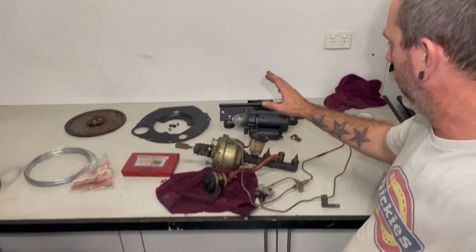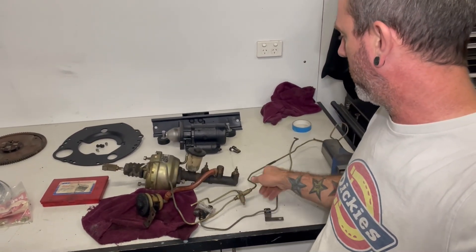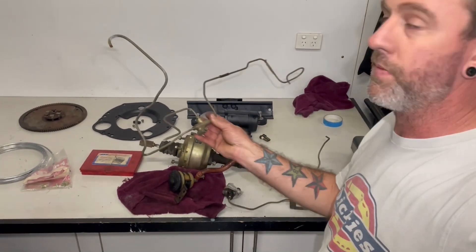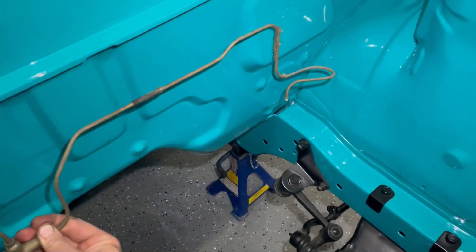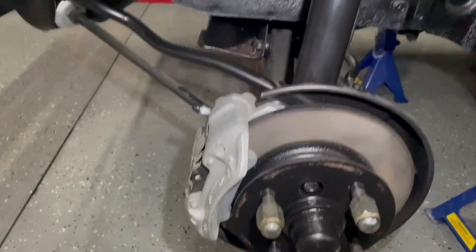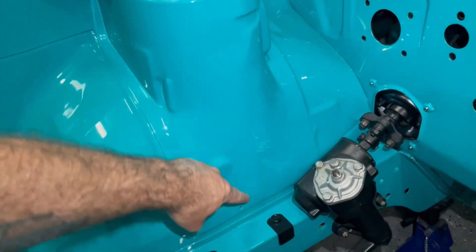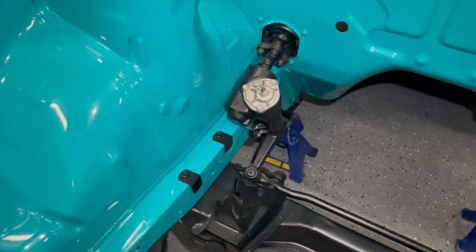I've just had to dig through all my stuff to find the brake master and booster, but I've just remembered that I don't even actually need to mount that to the car. The front brake line comes out of the front port on the master cylinder which then feeds into this T-piece, so really I just need to mount the T-piece and then run the brake line over to that left front wheel. So originally because I've filled in all the holes in the engine bay - this used to sort of mount to the firewall like so and then go in through the inner guard - because I've welded up all the holes, that's no good to me anymore. What I think I'm going to do is actually mount the T-piece down here, that way I can just run the brake line straight from the master, straight into that, shoot down here for the driver's wheel, and then shoot across the cross member for the passenger wheel.